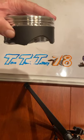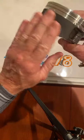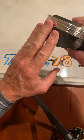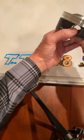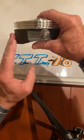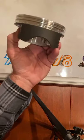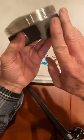Now, this piston is very safe, in my opinion. These have held up really well under high-pressure situations because the major thrust skirt is a full skirt. This would go on the front piston. Also, if this was the rear piston, the major thrust would be on the rear of the rear piston, and it would be on the rear of the front piston. So beware of that when you get custom pistons or you get these cool engines that got both sleeves notched, because they have to be, and then you got the notch on both pistons in the middle.